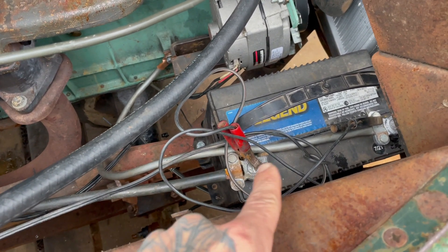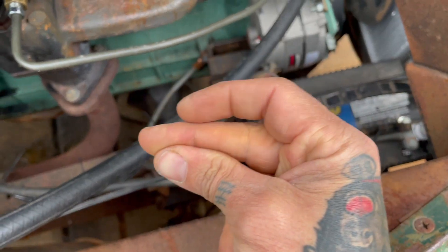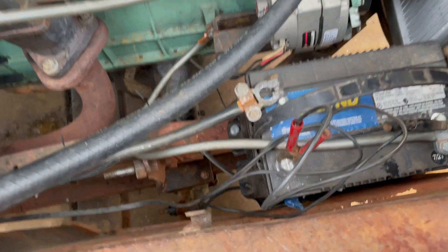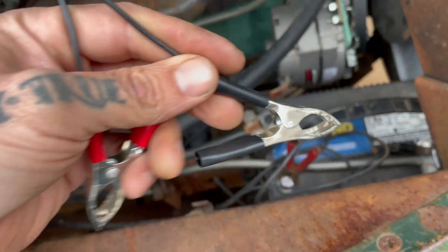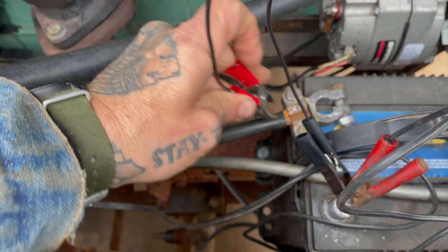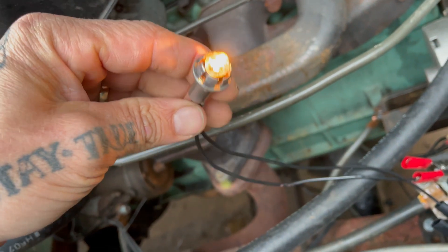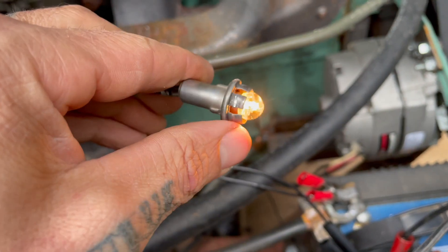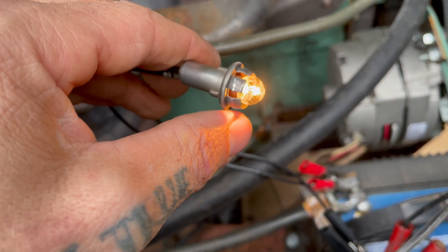So here's the trick. I'm going to remove the positive terminal from the battery. All right, so with that off, take your test light — clip it right on here and clip it right on there. Now check it out: the light's on. So what this tells us is that power is flowing through there, and if there's no voltage drain, this light won't be on.